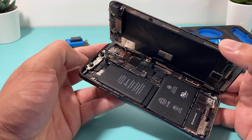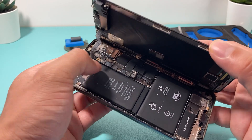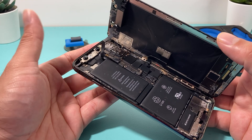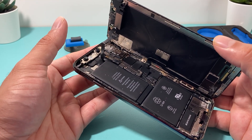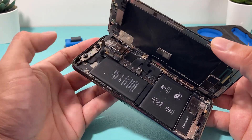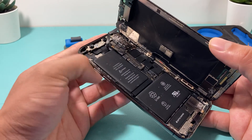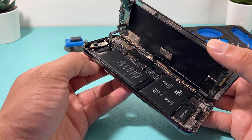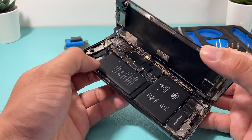Hopefully this helps you guys if you're having this issue like I was for some time. Go ahead and try to disconnect that flex cable right here, update the phone, and that should be at least a good indication. I think maybe about 80 to 90% of phones experiencing this exact problem with the iPhone 10 boot loop could try this out if you have the tools. Let me know if you guys found a better solution — I want to hear from you. Hope this video was helpful; please hit the like and subscribe button. Thanks for watching, see you guys next time.